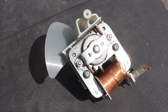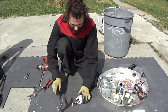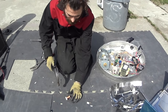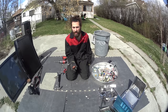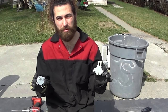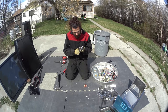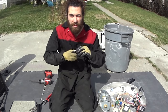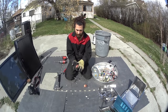First and foremost, let's do the fan motor — it's less complicated than it looks. You can see these seams on either side; those are just holding this winding of copper together with pressure. So if you give them a decent whack with a hammer, you'll eventually get that piece out, get that piece of metal out, slide that stuff off. Super easy — you've got a handful of bare bright copper. Now these things, the motors from the underside that turn the plate: most motors of this nature you would just want to throw in a motor pile because it's a big pain in the butt. But these ones, if you just pinch them open at the right spots, it's actually pretty easy to get them open and separate the copper. Another pile of copper.